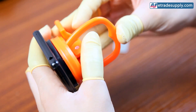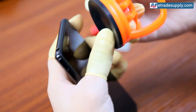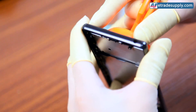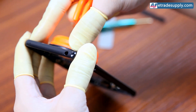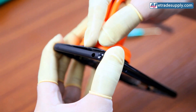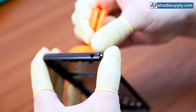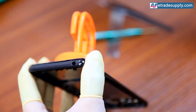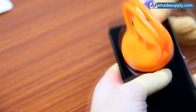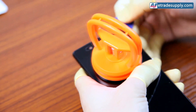Starting at the top, you'll want to use your suction cup tool to open up a gap for your case open tool. Then just gently work the screen loose. You want to be careful near the bottom though, as this is where the flex cables are located.